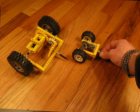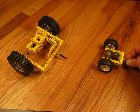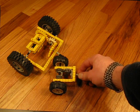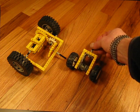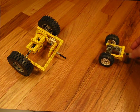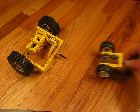If you take an open differential and you turn the drive shaft, the differential drives the piece of machinery that you've got. You can also see that in a turn, one wheel is turning more than the other while the thing is still driving. That's what a differential is supposed to do — equilibrate between the two drive wheels.